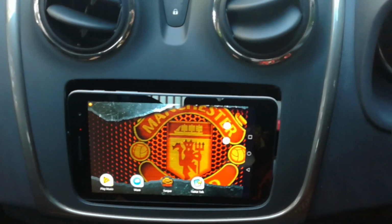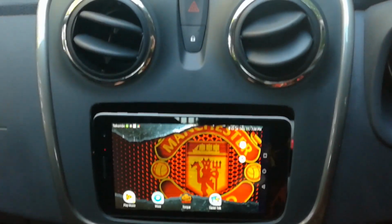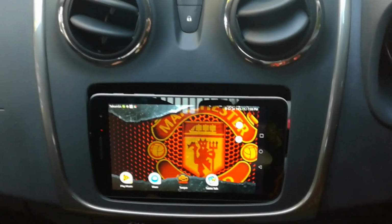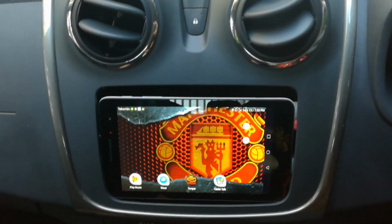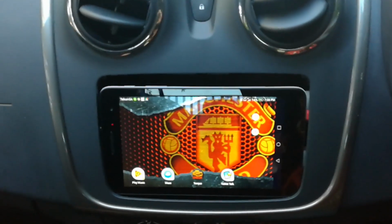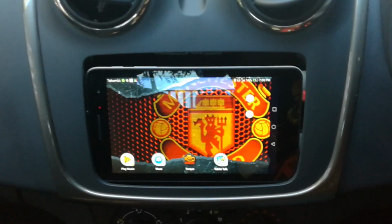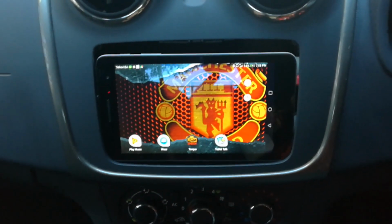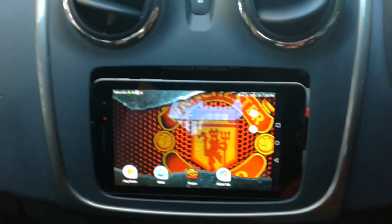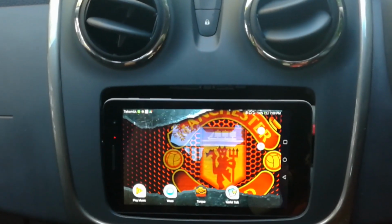With a tablet mounted in this way, fully mounted in the vehicle so that you can't take it out, or you don't want to take it out, you run the risk of the tablet overheating on hot days. I've noticed on a few days when my vehicle stands outside in the sun, the tablet tends to heat up because there's no real ventilation and no fan at the back of the tablet to keep it cool. Charging does cut out. On this tablet there's a built-in function, or at least I think there is, that when the tablet overheats, it prevents charging from happening. So if you're going to mount it this way, be sure to add a USB computer fan at the back and plug it into a USB port or something of that sort to keep the tablet cool. Otherwise the tablet will overheat and you'll have to wait for it to cool down in order to get charging again.